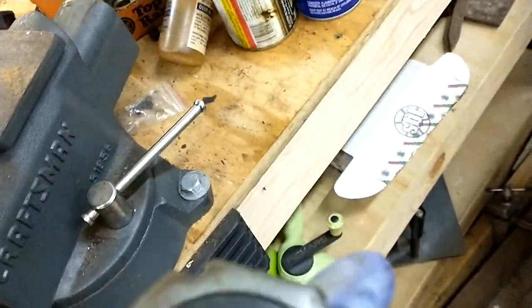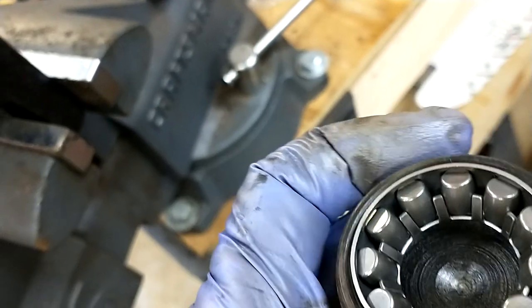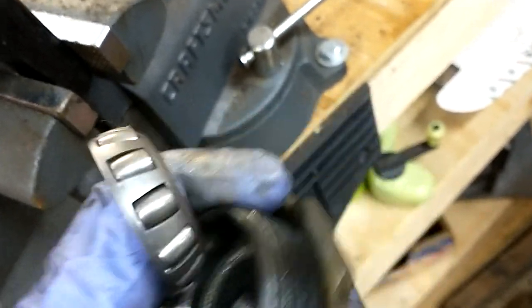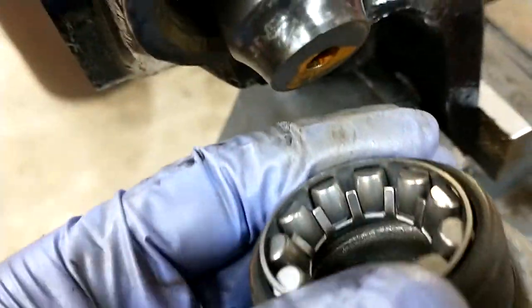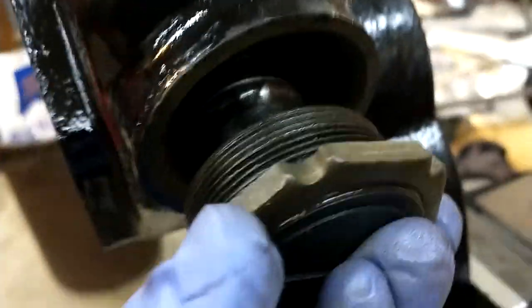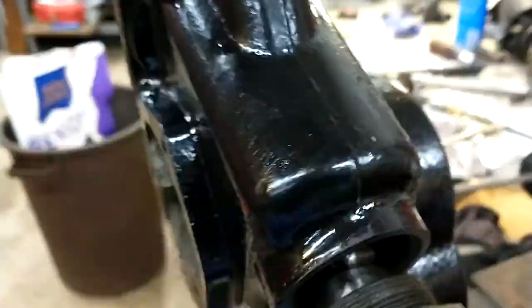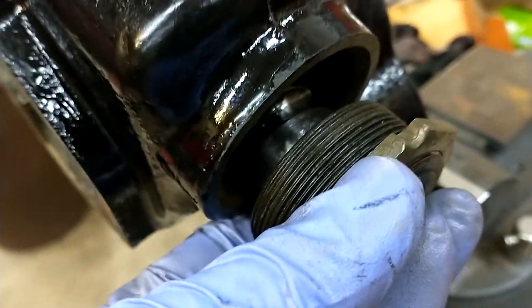Now you've got the worm adjuster — it's this big threaded cap with a lock nut on it. The other worm bearing goes in here and then that rides in the end of the worm shaft. It threads into the housing — it's a two-handed job. You're going to want to lift up the shaft a little bit and wiggle it around, get it centered, make sure the bearing on the inside of the cover is seated, and then screw it in. Just get it started to hold it in place. I'm going to pause now and we'll come back to it.